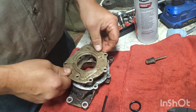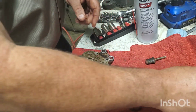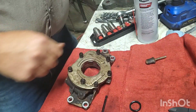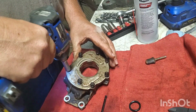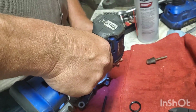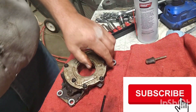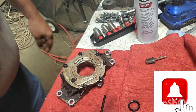So we are reinstalling the cover at this time right here. I'm not going to tighten it super tight because, like I say, once I go to install this on the engine, I'm going to recenter everything, and all I'm doing here is just snugging these down very lightly, nothing hard. Don't hammer these in. Even when you're ready to be done with it, do not hammer them in. There is a specific torque spec for this, and I will do my best to try to bring that in on the next video when we install this on the engine and show the results of our upgrade on this stock oil pump.